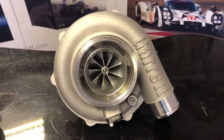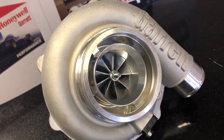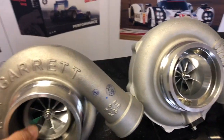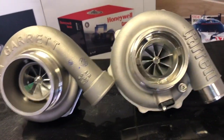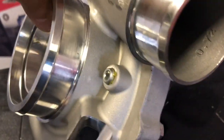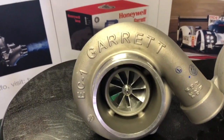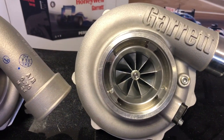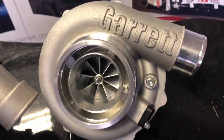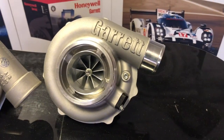The compressor housing is noticeably really large. Comparing it side-by-side to the GTW 3476 — the AR70 compressor housing on the GTW is in the TO4E family, and the G30 770 runs an AR72, a slightly larger AR in terms of volute size and flow capacity. The GTW actually has a larger compressor wheel at 76mm exducer versus the G30 at 71mm. The G30 is also a nine-blade design with a really compact size to the compressor, giving a much better linear response while maintaining extremely high flow capacity.